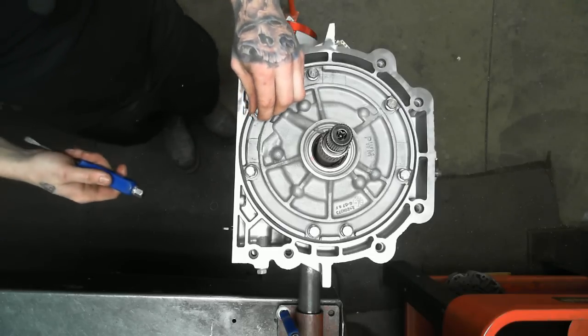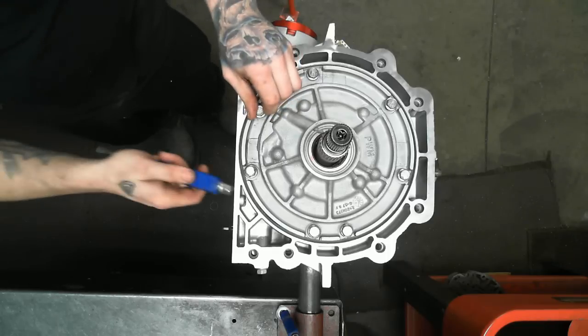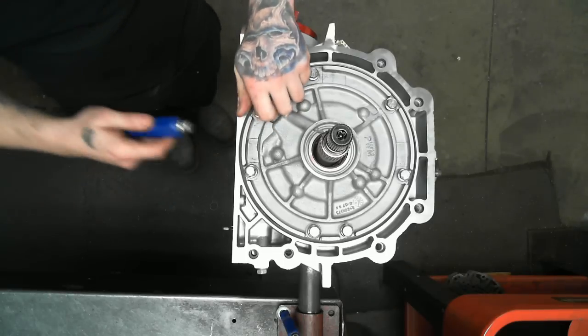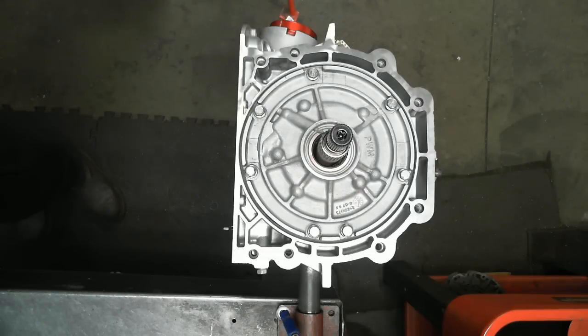Onto that topic, to prevent leaks, some of you may notice I'm using a little bit later style case with an earlier O-ring pump, and I'm actually going to put a compression seal in this also, and that's kind of a special double seal that I've been doing recently.